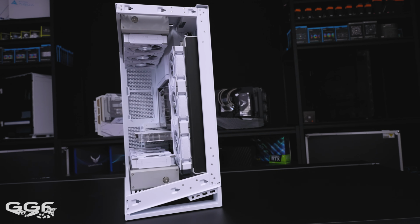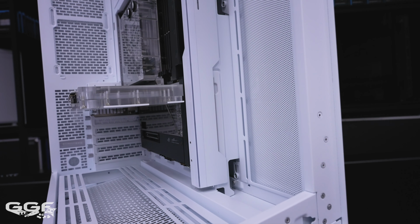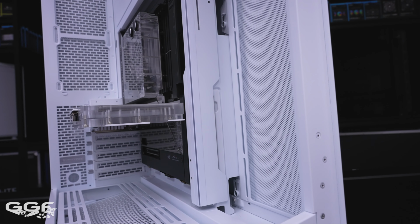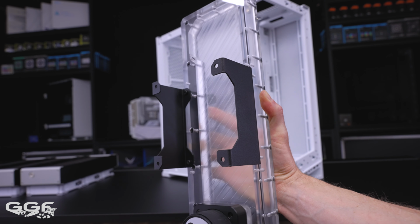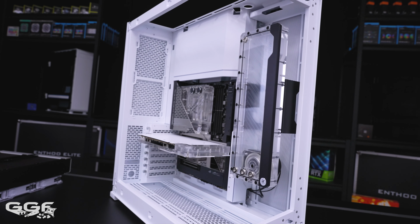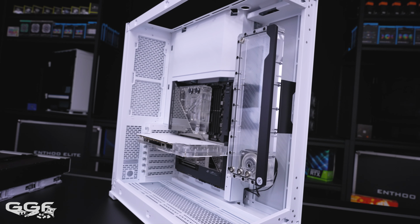Pretty insane. One thing to note that once this side rad bracket is installed, there is no room behind it for side distro pumps. Side distros being installed onto this bracket will either need front-facing pumps or for EKFLTs, the supplied brackets will need to be used.